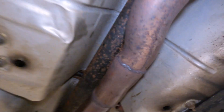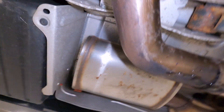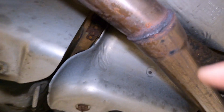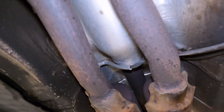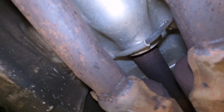Let's go further back to this custom exhaust: one custom pipe, two custom pipes, three custom pipes - let's put a fourth one in there, four - and then they actually have a decent muffler. Who the hell welded this? The welds are not bad, they're not leaking like this exhaust sleeve. Whoever welded that didn't do too bad - must have done it on a bench. But here's where you messed up - look at the O2 sensor wiring. It's heating up; they didn't route that properly.